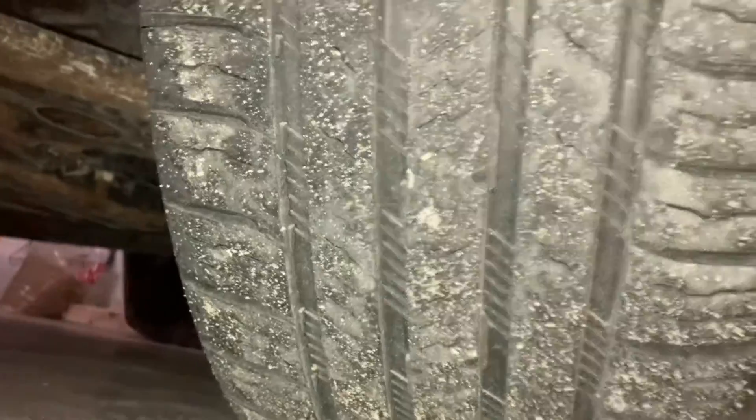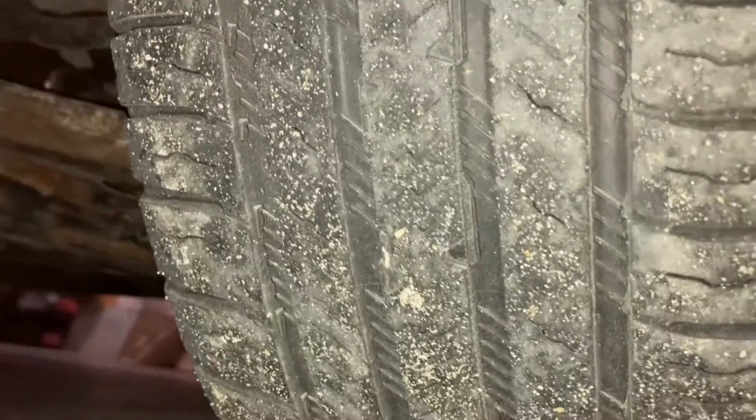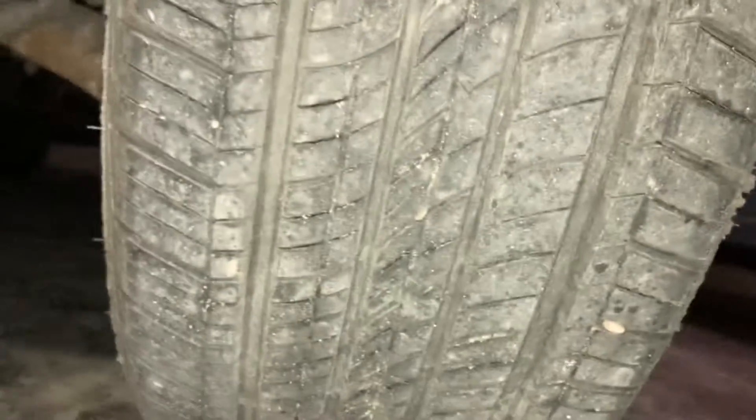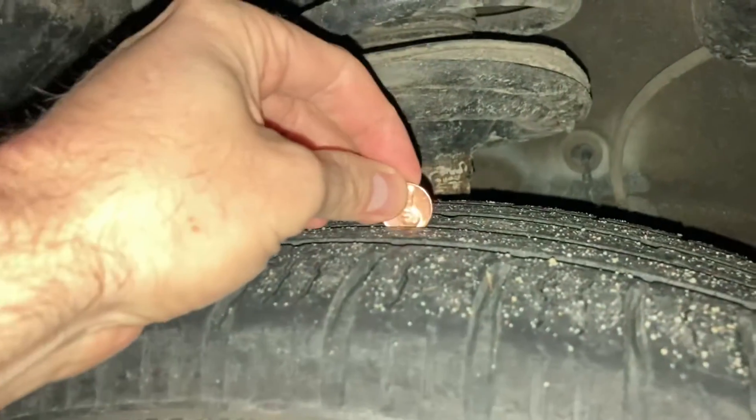Check out your tire — we're moving out into the garage. One of our vehicles has tires with little grooves or strips on the inside of the tread. You have to be careful your measurement tool doesn't get placed on top of those, or you'll get an inaccurate reading. Look at the side of your tire before you start. Our other vehicle does not have these — it's just a straight groove with no cross-sections inside.